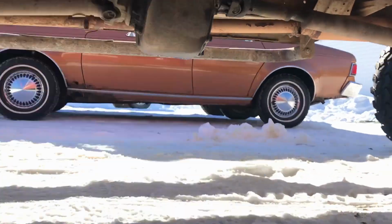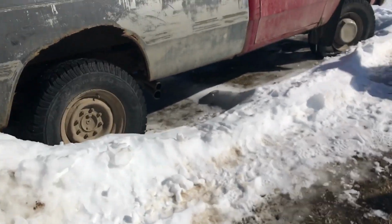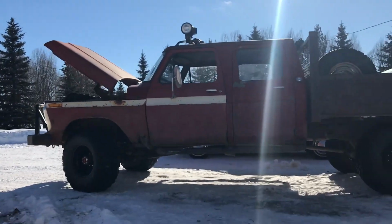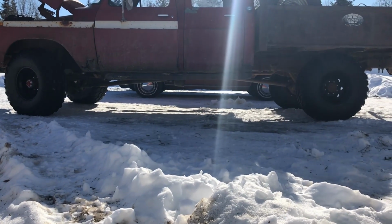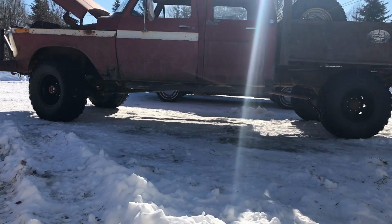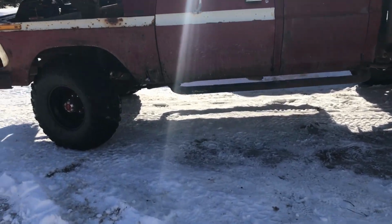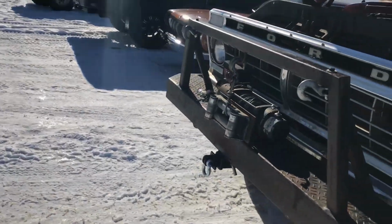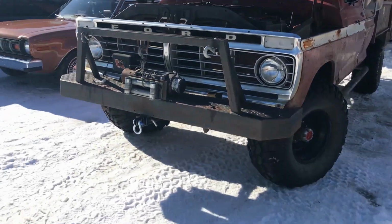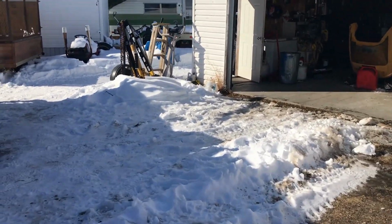And the reason Ford did that is actually a selling point, because this is a highboy, a true highboy, which meant basically factory lift kit, but Ford centered. I don't know if you can see it. Ford centered the transfer case in the truck, so the front and rear drive shafts are nearly equal, allowing you to lift the truck up higher and keep the U-joints reliable. You're not always going through U-joints. That was basically the main reason. Keep the geometry proper, but get the truck up high. It was a great idea. I like it. You run into more vibration issues with that one extra drive shaft, but it's really not a big deal.